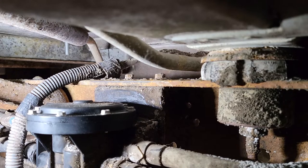Well, hey, we saved a lot of time, hopefully, not taking this pump out. I think they're about $250 for a fuel pump. Oh, I call it a pump, but it's not a pump. This is the selector. Most people were aiming us toward the fuel tank pump. People try and tune with their pocketbook, and that just doesn't work. We were told it's probably the pump in the fuel tank that's gone bad, but we could hear the boost pump in the tank working. So we knew better.